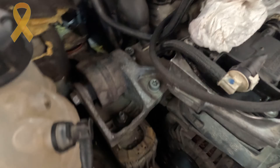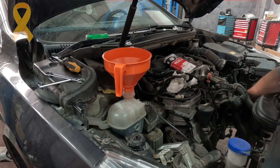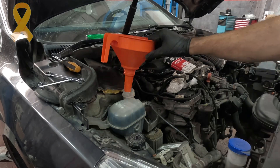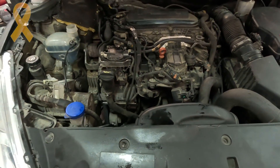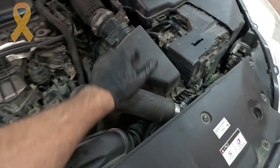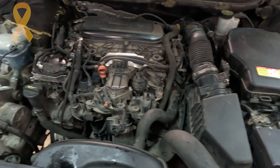To lift the engine I also had to put back the engine mount. I cleaned the expansion tank and put it back in place, and filled the cooling system with fresh original PSA coolant. Everything is back together — all the hoses, all the electrical, the air filter, the battery. Now for the moment of truth — let's see if she starts.